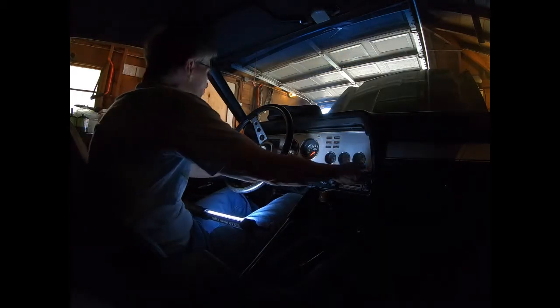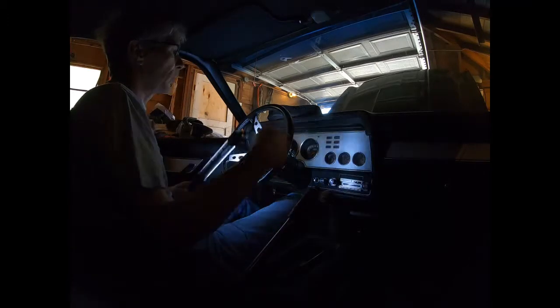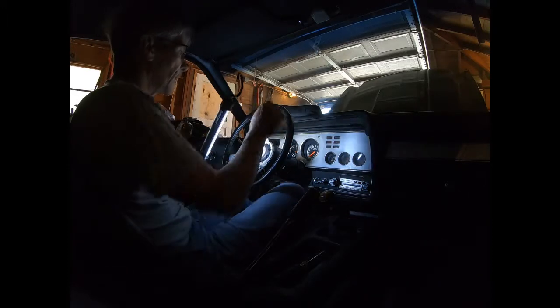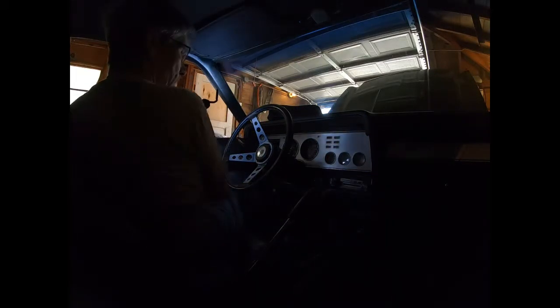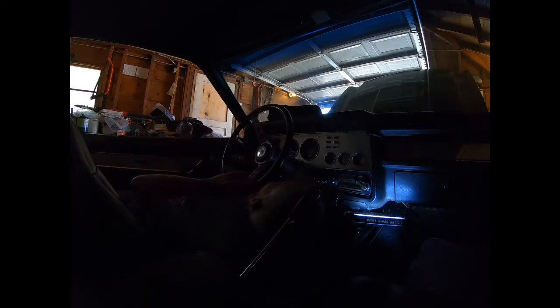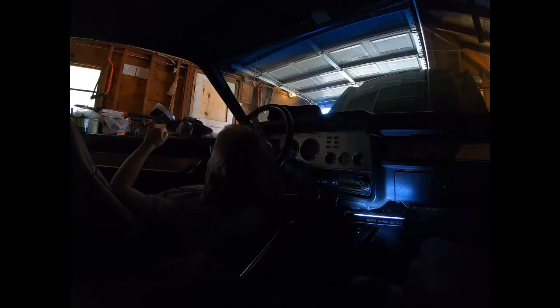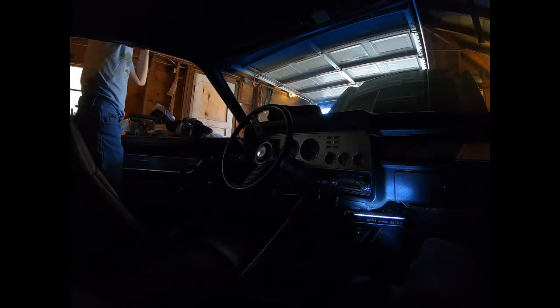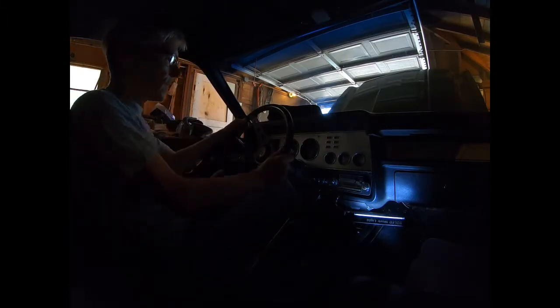we got to do is carefully, oh, that's what else I got to do. I got to pull the speedometer cable out. Oh boy, back under we go. Speedometer cable is out. There's a little tab on the top right next to where the shaft is that you push down, and then you can slide it out. Releases the latch. Alright, so now I think we carefully lift this out of here.